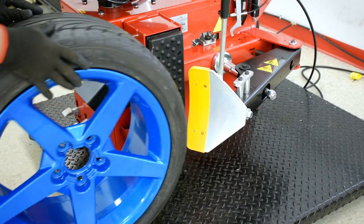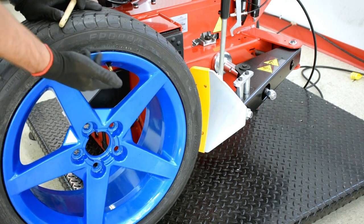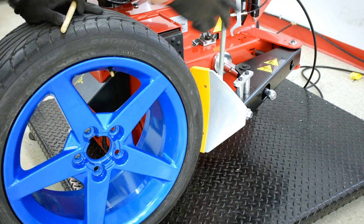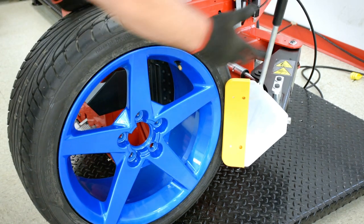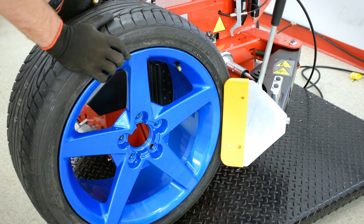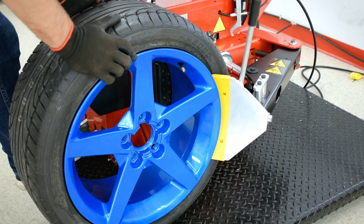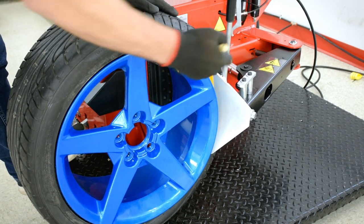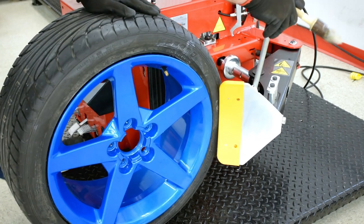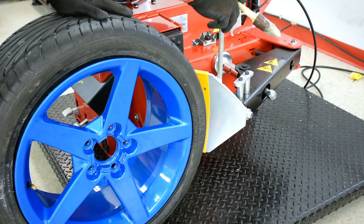We are going to start changing this tire, beginning with the first step: breaking the bead. Make sure you release the pressure from the tire — never break a bead when it is fully inflated. It is always a good thing if you have a TPMS sensor not to step on the sensor with the shovel. With the pedal on this side, we will start breaking the bead. It is always great to use some lube, even on an old tire you're getting rid of, as it will make it easier on the operator and on the machine.